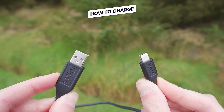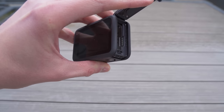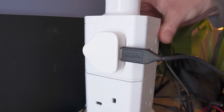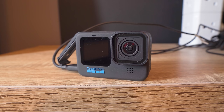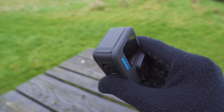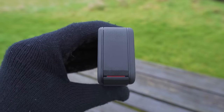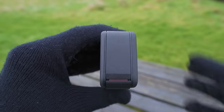To charge your battery, get the USB to USB-C cable and attach it to the USB-C port beneath the battery door, then connect the other side to a power source. When charging, you will see a red light on the front of the GoPro come on. This stays on until the battery is fully charged — which can take a few hours — and you will know it's fully charged once the red light turns off. After charging, make sure the battery door is fully closed with no red showing to ensure it's 100% waterproof.